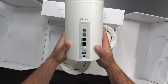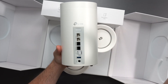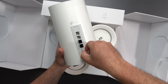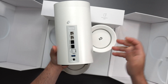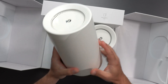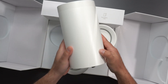So this thing is massive. We can see the ports right here — we have the WPS, two 2.5GB ports, two 10GB ports. They didn't even bother putting gigabit ports on this because this is too fast for that. These are a combo port, so it has the SFP, which is basically the fiber optic. These are less common in home units, more common in business units. But this is Ethernet, obviously, RJ45. And we have a USB 3.0, power. It looks like they put the 7 here with the shape just to make it — yeah, I think that's a pretty cool design.